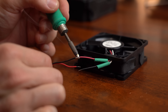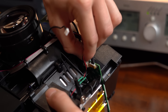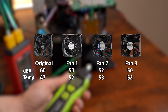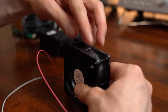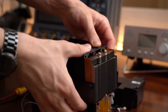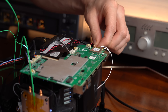Now before installing the new fans, let's clarify that my old system created around 60 dBA right at the heatsink and its max temperature was around 47°C after 20 minutes. With that in mind I installed the 3 new fans one after the other and repeated the same test over and over again. I am super happy to see that almost all fans achieved a 10 dBA drop. But for me the winner is definitely number one, and I honestly feel like we can use that permanently because a 5°C increase should not harm the LED that much. What stood out to me during testing though was that the projector was still kind of loud even when using a pretty much silent fan, and that is when I realized there was another fan hidden inside this thing that is now the loudest.